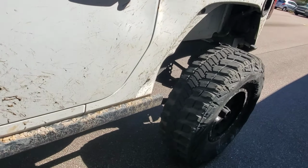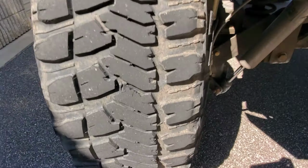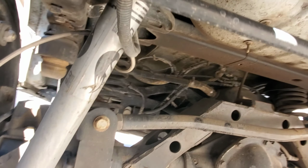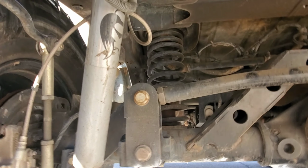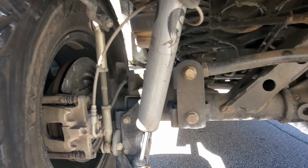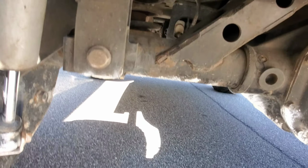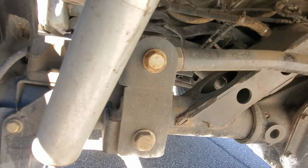Another thing I did when I stretched it: I knew I'd eventually be moving up to bigger tires, so I didn't need a whole lot more up travel than what I had, but I still wanted to keep the flex. So I had Carnage Motorsports do this stretch. People call them the Stretch Factory for a reason. They knock out a ton of these. They moved the shock tabs at the top, so less up travel but more down travel, and that's a trade I'll make every day of the week. The Rockcrawler track bar can stay the same on the axle side.